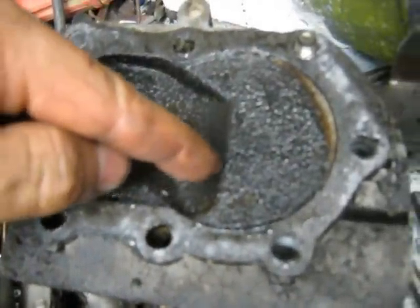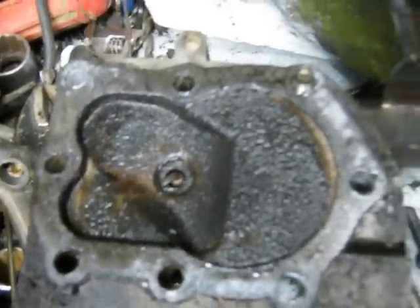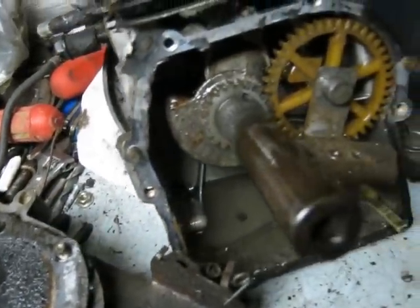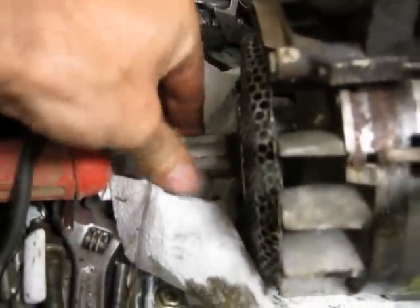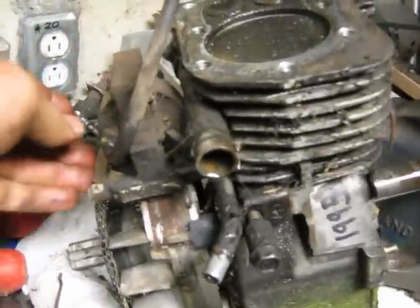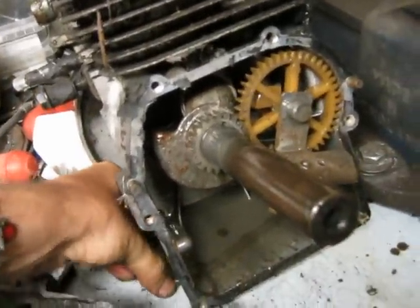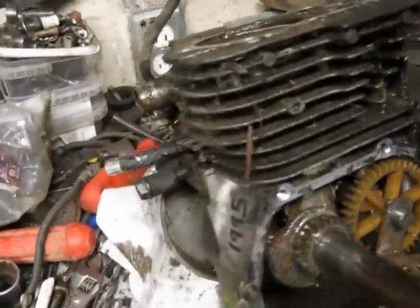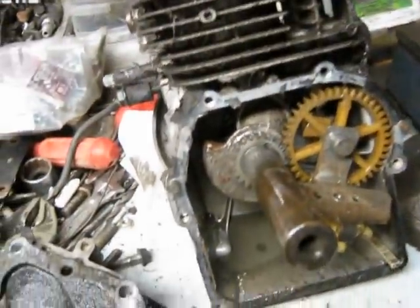It continues in from both sides at a shape there, so you end up with more of a V-shaped combustion chamber. I don't have one handy here or I'd show it in the video. It still has the old style recoil starter there, which I was kind of surprised at. So that's the 1995 Briggs Sprint — drop down to 3/8 crankcase cover bolts as well as the 3/8 bolts up top on the recoil starter cover.